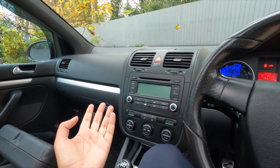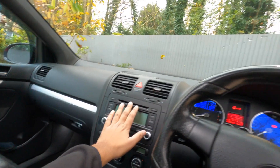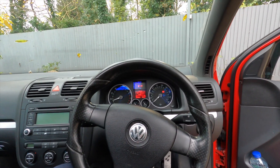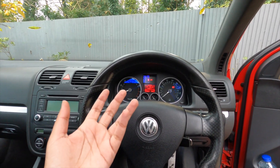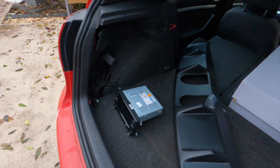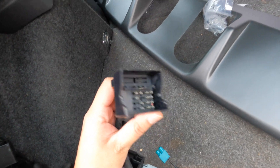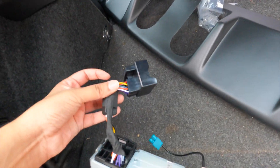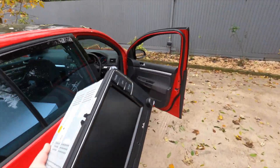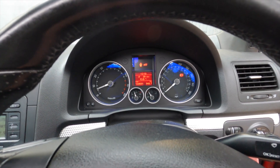To give you an idea of how I prepare for these videos, I have already fitted the RCD330 and then took it back out for the video. So I had that exact head unit installed in the car for about a week. This is an '06 R32, so it likely has the older CAN bus. I had no battery drain because I had an extra cable. This cable here - this is the adapter you normally buy for your multifunction steering wheel. This car doesn't have it, but I've read that this extra bit is like a CAN bus simulator. The battery was fine after a whole week.